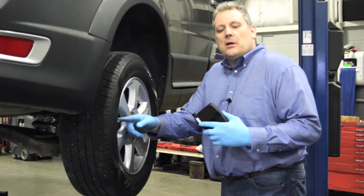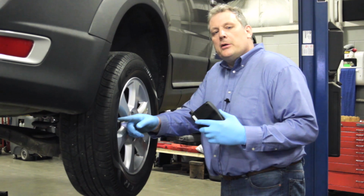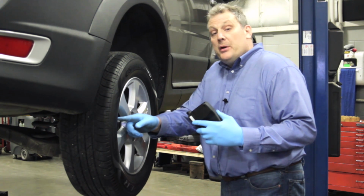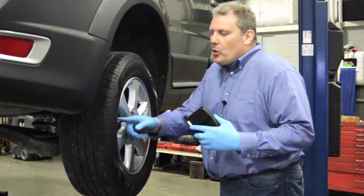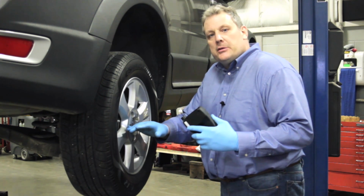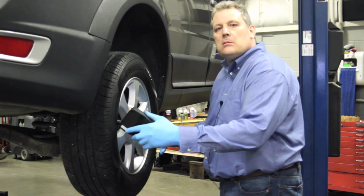In this tire and wheel assembly, we've installed the QS103R red sensor, which is our European application with a metal valve stem. We've pre-programmed this sensor prior to installation, but if you happen to have installed the sensor and didn't program, don't worry. Just remove the valve core, bring the air pressure down to 0, and you can go ahead and program that sensor right in the tire.